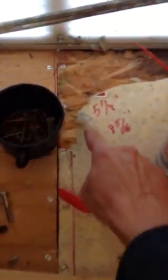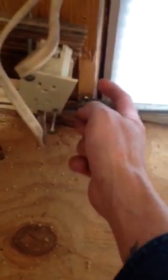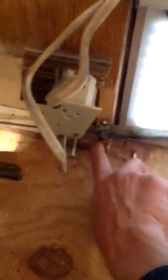So I cut down everything, cut on the member up under the camper along here and along there, and screwed both sides with the screws and nuts on the bottom. I just don't like self-tapping screws on some metal that thin. I want it to be sturdy. So I replaced it with 3/4 inch plywood, and I got to replace this panel in here. I've just pulled that out, so I had to put some screws up through the bottom, through the plywood into this piece here, so I wouldn't have to toenail a screw and split that board. So it's nice and sturdy.